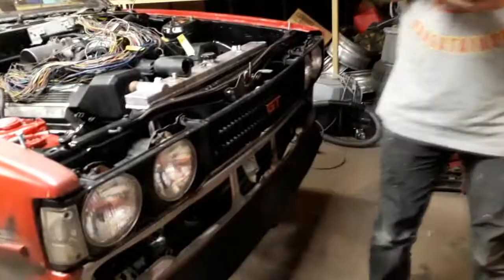Have you checked bonnet clearance? Yeah - it touches but I think you just need to cut the center out. Is there any way to sink the radiator down? No, it's already touching - it actually needs to come up. The radiator came out of an R32 Skyline. It's a mismatch of everything. Primera rear brakes, C33 Laurel front brakes. Every time I go near a Corolla it ends up with Nissan parts. Because Nissan parts are everywhere - people are parting out Skylines.